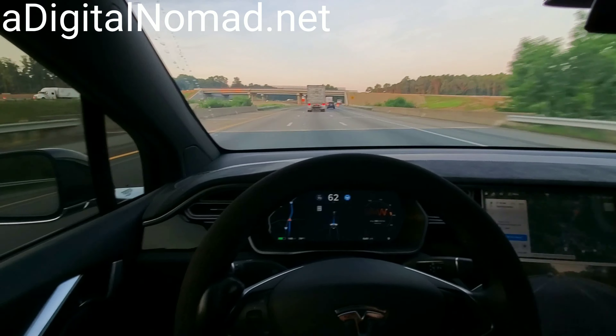That's been the challenge with vehicles all along — trying to perfect that. Porsche has tried with their mid-engine Boxster design, which is actually the best internal combustion engine design, or their original rear-drive 911 with the engine in the back. But even that has problems because all the weight's in the back. The DeLorean was like that — it overhung in the back, just a reverse of a front-engine design. And Porsche with their 944 put the engine in front with a long tunnel driving the rear wheels, putting the transmission over the rear axle — more complicated and prone to breaking down, but it helped with weight balance.